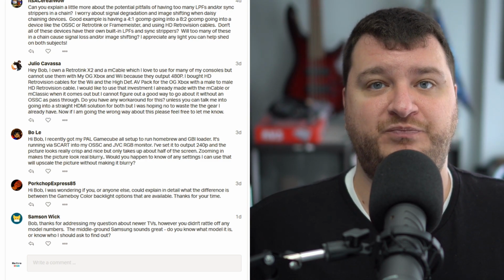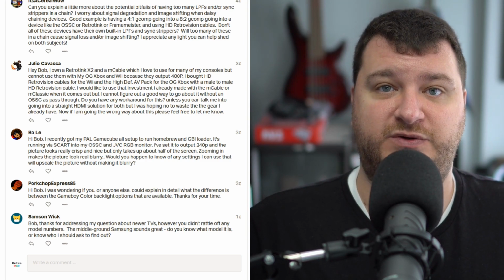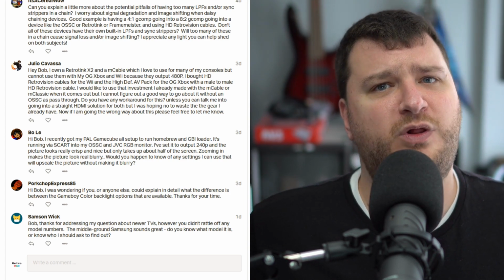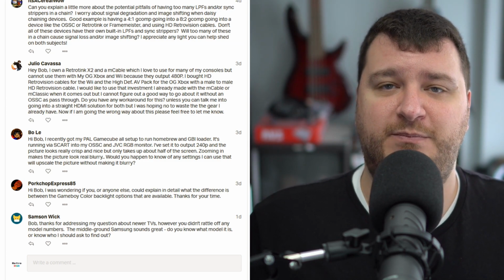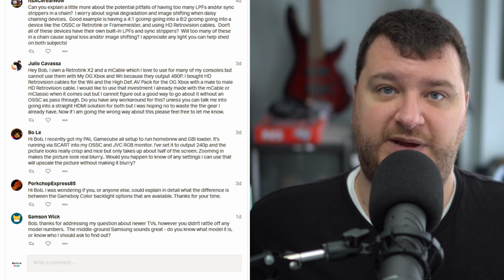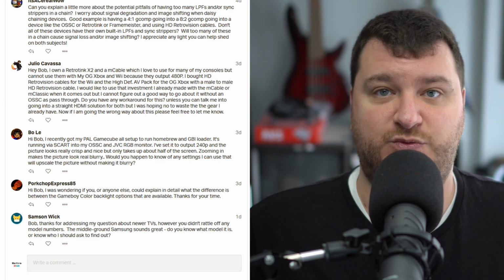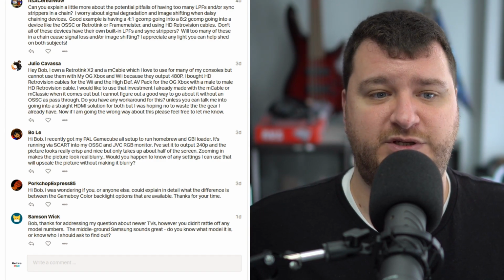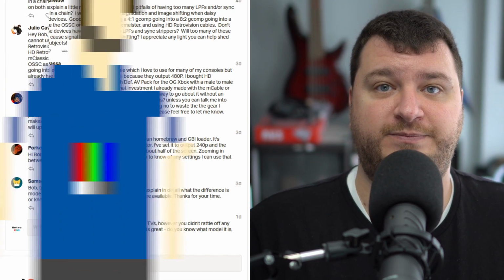Just once again, though, if the Wii or Xbox goes to 480i mode, then it's not going to work through the M cable. More specifically, it might work going through the M cable, but it's just going to pass through. It's not going to process the info. So give that a try. Let me know what you think, and hopefully that's the solution for you.